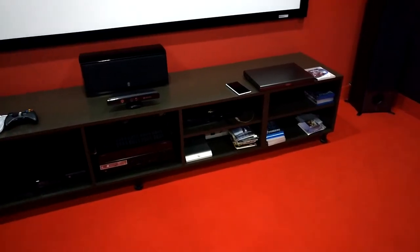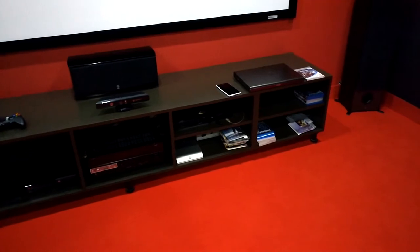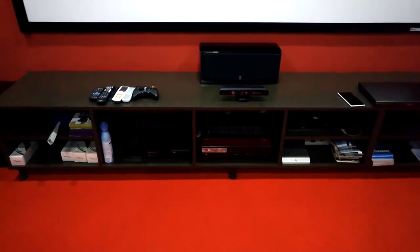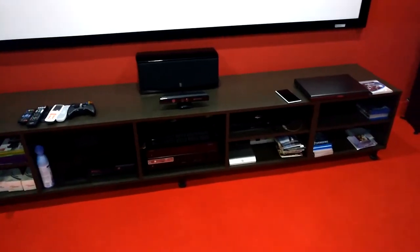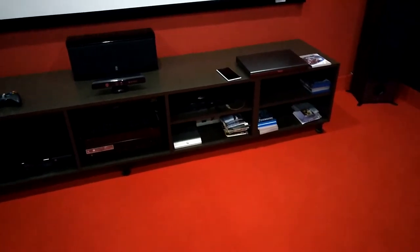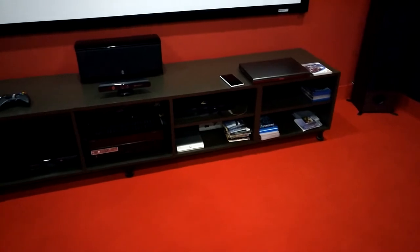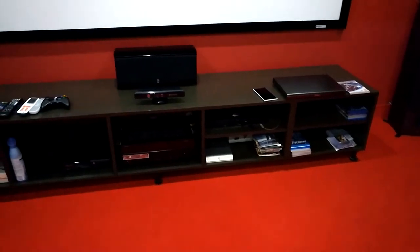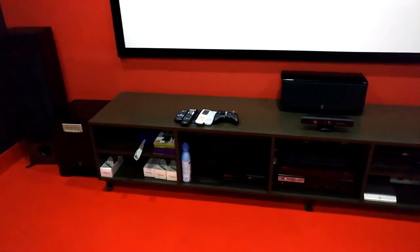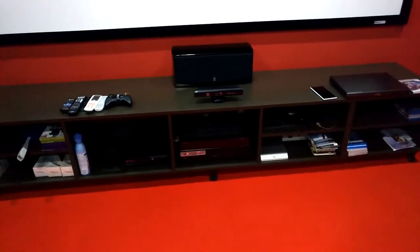When you construct a home theater, you should first think about having an uninterrupted power supply. This equipment is not friendly with zigzag power signals, so you should always provide good quality power. It's better to have a good inverter or UPS system to support uninterrupted power supply, because the projector always needs continuous power, as it manages its cooling system internally. You can't have interrupted power supply in between, because it will shorten the life of the bulb inside the projector.